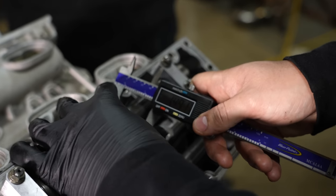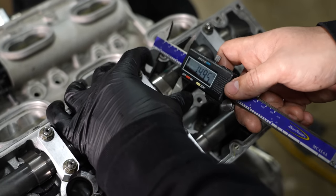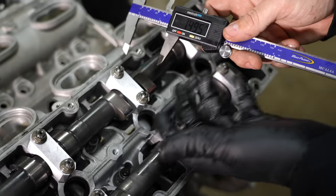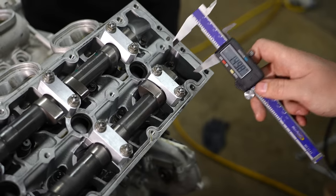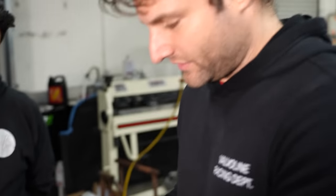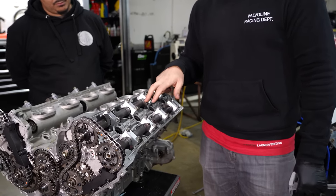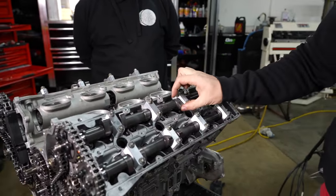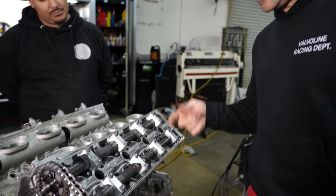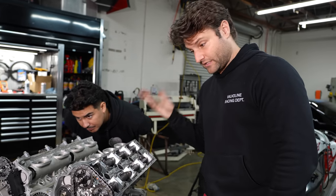This is the intake cam and we're measuring it at max — we're at 1.49 and change, so we'll say 1.5 inches. Then I was like, okay, that's going to be the same for the other — nope. That is 1.45 — so it's 50 thousandths smaller. That bill that was offering to sell me his intake cams that he ground down — technically they're basically the exhaust cams because he said they're 10% less. These are one inch wide with an extra half inch of lift off of that, so that's 0.5 inches. 10% of 0.5 is 50 thousandths, and that is exactly how much smaller the exhaust cam is. It's the intake ones that really trash the intake valve springs.